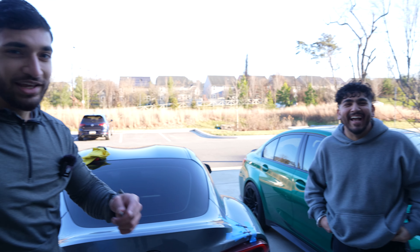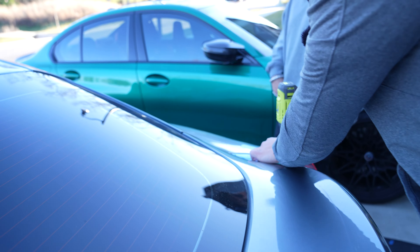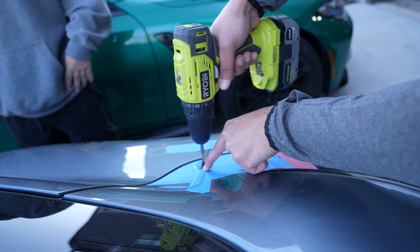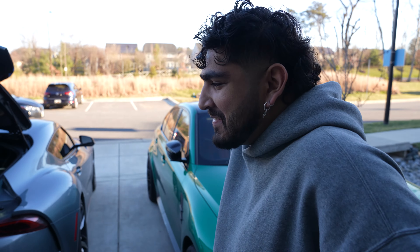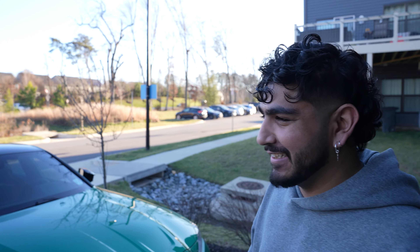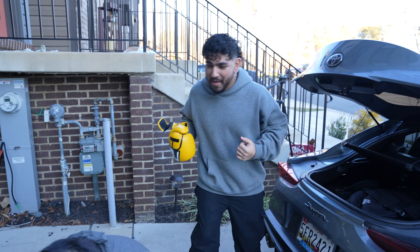So this is what I was referring to with the tabs — make sure you tape them down so they don't move. Do that on both sides. Now let me hold these tabs down just to make sure. So now we know exactly where we need to drill: right here, right here, right here, and right here. That gives us exact drill locations on the spoiler itself, matching the exact mock-up we just had. Now it's just a matter of drilling those in.